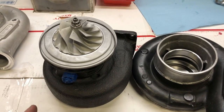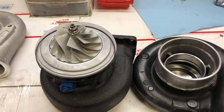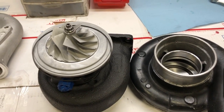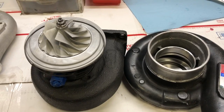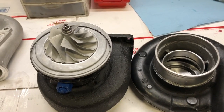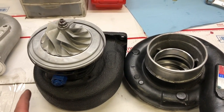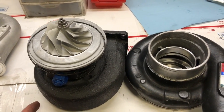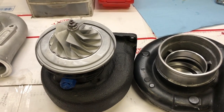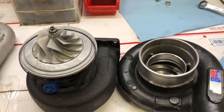I also want to mention our upgraded rebuild kits for the H1C. I sell upgraded rebuild kits for these and that's the only kit I use in these turbos — it's to make them more durable. The main purpose is so that you can run more boost without ruining the thrust bearing. If you have the factory thrust bearing you can have problems when you start to turn up the boost. If you never plan to up the boost beyond factory design, you'll probably be okay, but it makes sense to do the upgrade.